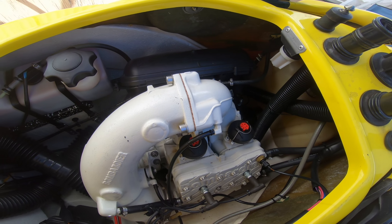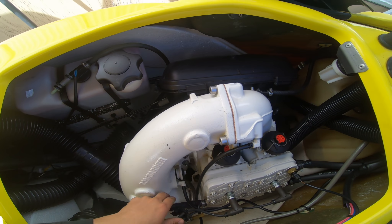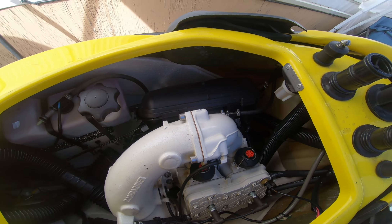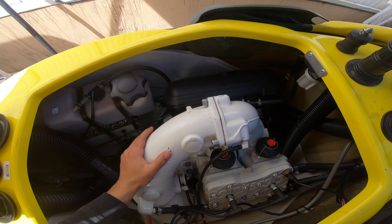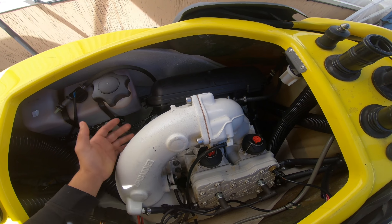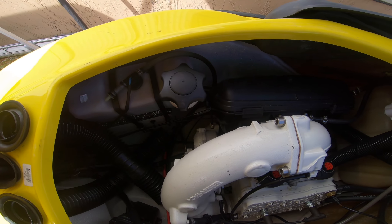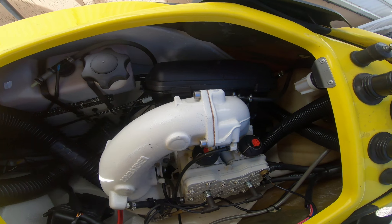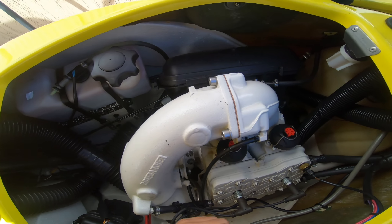The plug on the other side is pitted and has a couple of holes in it, so I think I'm gonna have to unbolt this, remove it from the jet ski, and see if anybody can weld that for me. I also had another problem — the jet ski stalled on me during testing. I don't know if it stalled because it was cold or because the carburetors need work. The generator I traded was $100, and I traded it with no money on top for this jet ski, so I believe I did pretty good.